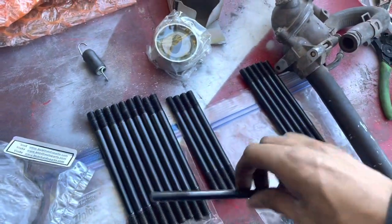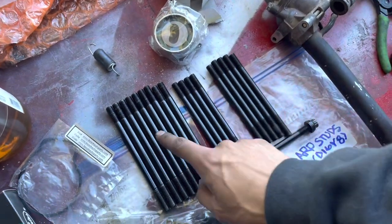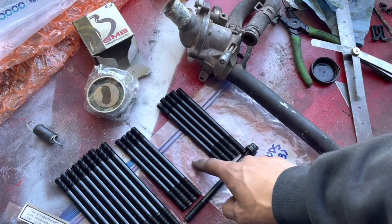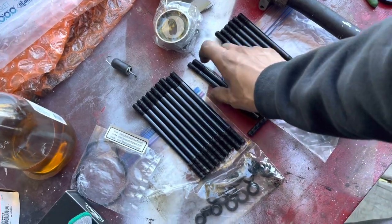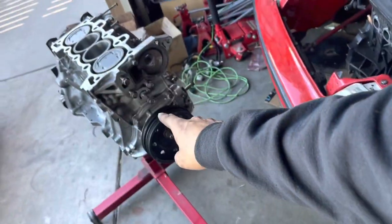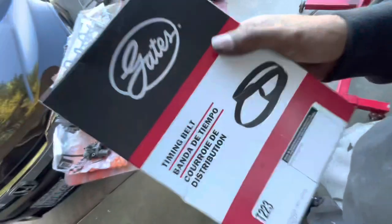Let me know if that's ever happened to you with Rock Auto purchases. We have two sets of head studs here — this is an incomplete set since Isa couldn't pull the last one out. This is D16 Z6, which is the 92-to-95 D-series VTEC, and this is D16 Y8, the 96-to-2000 D-series VTEC. The Y8 studs are significantly shorter than the Z6 studs. I've been led to believe we need nine Z6 studs and one Y8 stud to mate a D16 Y8 VTEC head onto a D15B — basically a mini-me.